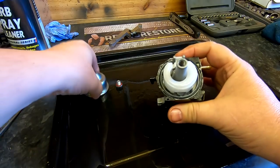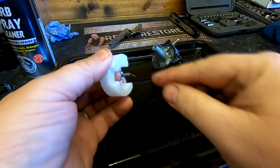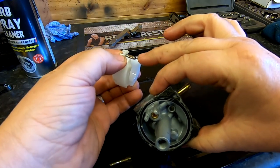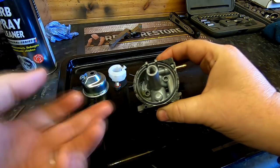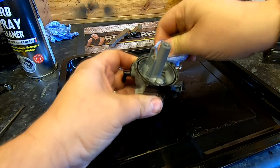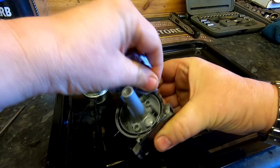As a matter of course I will remove the float. There's a little needle valve on the back of that — this one's got a little rubber insert on it. If it's got a rubber insert, that means in the seating there won't be an O-ring. If it hasn't got a rubber seal and it's a brass seat, you're most likely to have a little O-ring, and it's very easy to lose that when you're blowing out a carb without realising — then you get the carb flooding all the time. So that's just something to be careful of. In there is the main jet — I'm only interested in the main jet at the moment. I want to just wipe around that edge first where the air gun didn't blow out — I'm not disturbing the O-ring, I want that to stay in situ. A good-fitting screwdriver is essential when taking out jets.